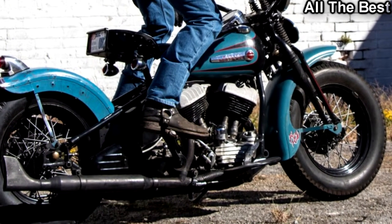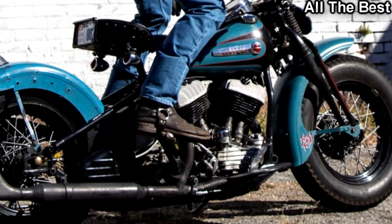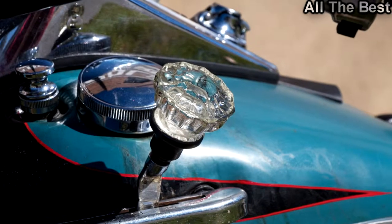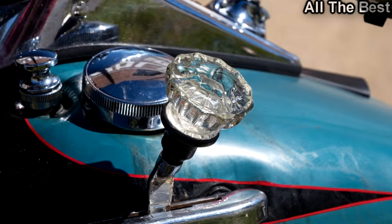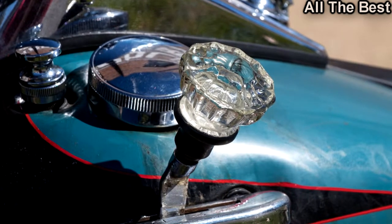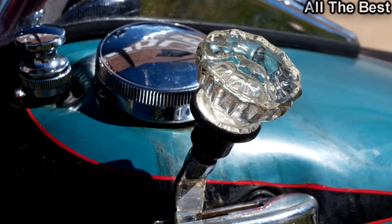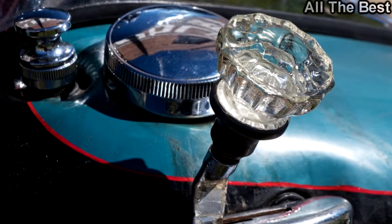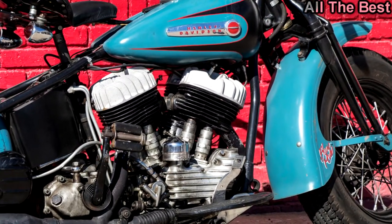The L rides on a hard tail frame, which means there is no rear suspension whatsoever. The lack of rear suspension is partially negated by the use of a sprung solo seat. This design works like a pogo stick in that there are a number of springs mounted on a single shaft inside the rear frame down tube and connected to the middle of the seat pan. A pivot point at the front of the seat is attached to the top of the frame to provide extra stability and only allows the seat to move up and down.